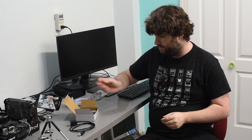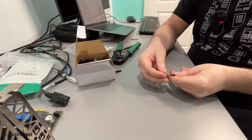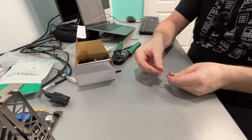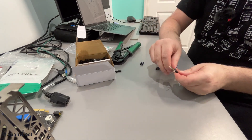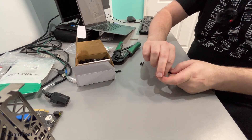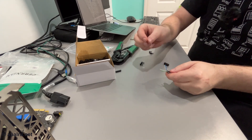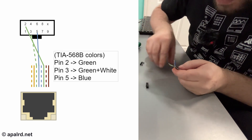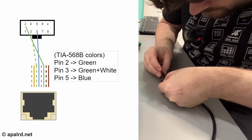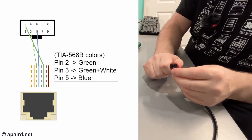Let's build up a cable. Let's cut the end of this right off. The center pins should be the blue and white pair — those are both ground. The brown and orange pairs are both going to be control signals, and the green pair is going to be TX and RX. I don't care about CTS, RTS, DTR, etc. It just leaves me ground, so I've got to pick one. There we go.